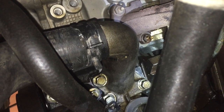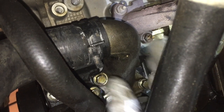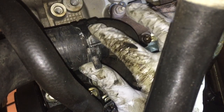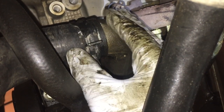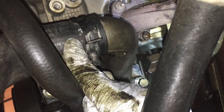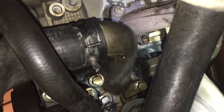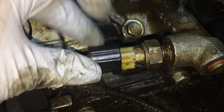We took our pliers, pinched that clip, and moved it right back over. Our adapter housing where the coolant connects is now reconnected with the radiator hose we took off. You always want to feel behind it — I can feel the metal right here — so we know the clamp is on enough and it's back where we got it from.